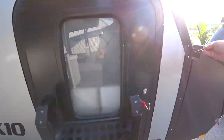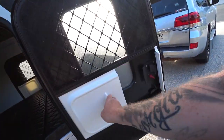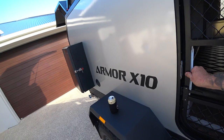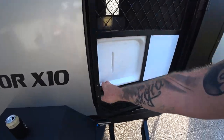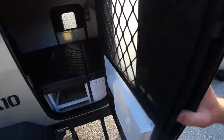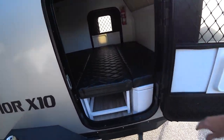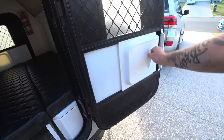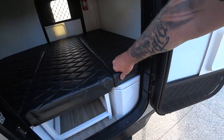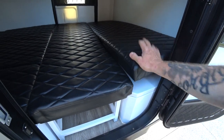To get inside, all you're doing is undoing that, undo this guy, drop — straight in. You've got fly screens if you want them. So you've got the fly screen there — really simple, clicks back onto the door. We took the covers off and trimmed about an inch off the side there to allow this to slide back and forward — it was getting crushed. And again here with this one, we went back to that point and cut a bit of the foam out of both sides.